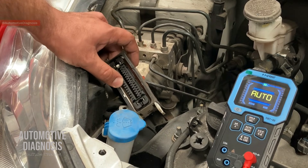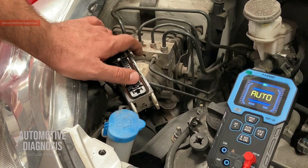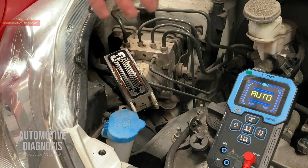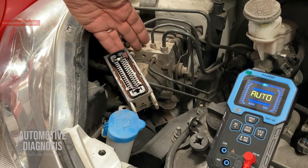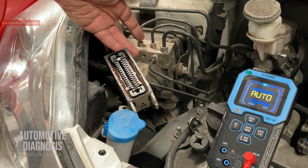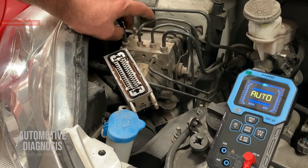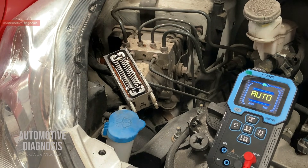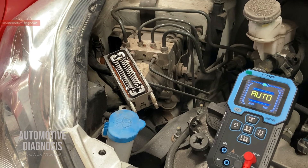What we saw was actually a good circumstance for the ABS module. If we had any problem, our measurements would have been wrong, but everything on the connector, wiring, and fuses came out okay. So in this case, if I have a problem on the ABS module and I get this kind of measurement showing everything is okay externally, I need to proceed to replacing the ABS module. The workshop manual asks you to replace the ABS module in this case, but we have videos on the channel explaining how to inspect everything inside the ABS module as well — you can find the links in the description. What we just measured covers the most common problems, and most of the time you can find the fault by doing this inspection. Thank you very much for watching — please visit the channel page for more diagnostic videos.